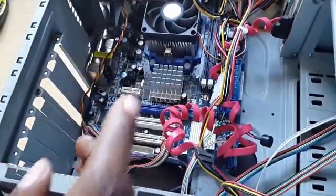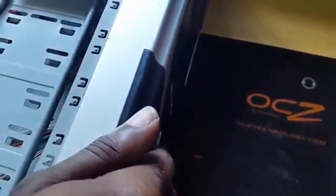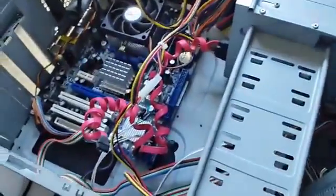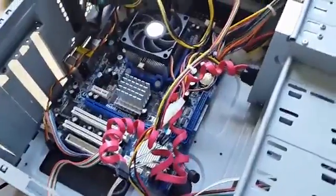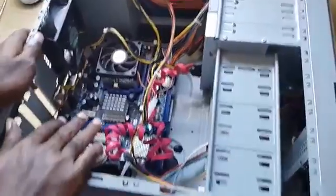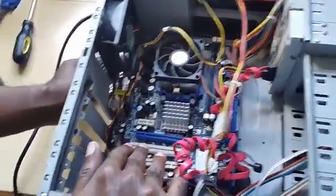All right. So just to quickly recap, so far, the first thing you want to do is the test where you remove the power cord, then you hold down the power button for a whole minute, and that should work in most cases. If it doesn't, you move on to checking your power cable to make sure that the power cable is delivering enough power. If that does not work, as I said earlier, you want to check your graphics card, if you have a graphics card in there, by taking it out and using the onboard connection.